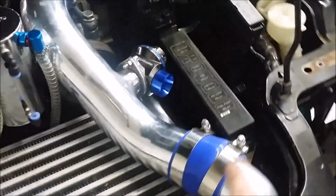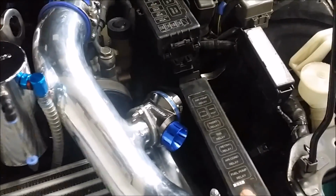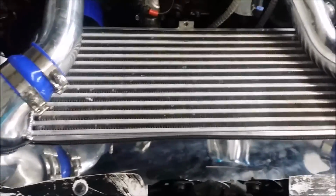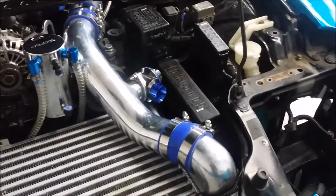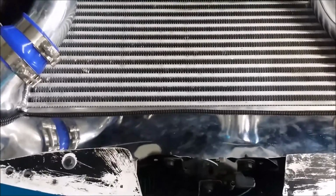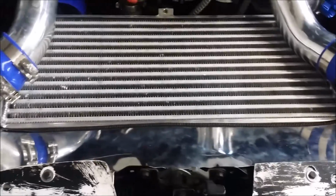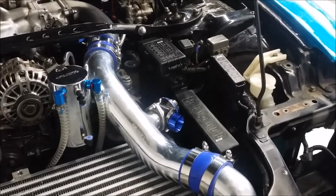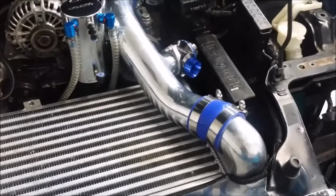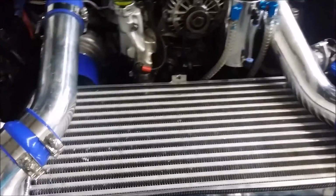We've got pickup points here. One back there and one on the other side. The one on this side actually also helps to support the relay box. So this initially was underneath here. Now, with this kit and this shielding for the V-mount system, you could actually keep it in place and not have it there, which would be a really clean look. The problem is that if you need to get to any of these guys, you're going to have to unscrew the bumper, take that plate out, get access to it, and then change relays and fuses and things like that. And I just wanted something that was nice and easy to work on, but also clean. So I deliberately moved it over there, which means extending the harness. But if you're not happy moving the harness, or if you want one less point of failure, you absolutely can leave it there. The kit will work with it there.